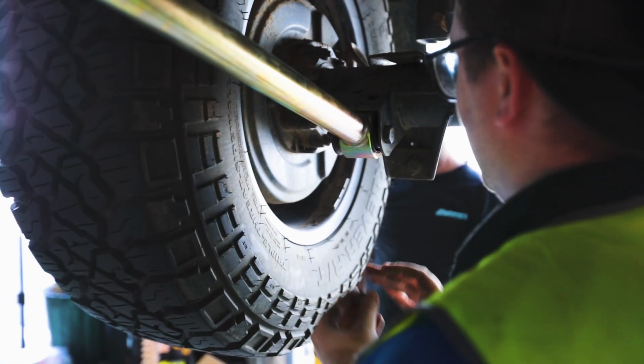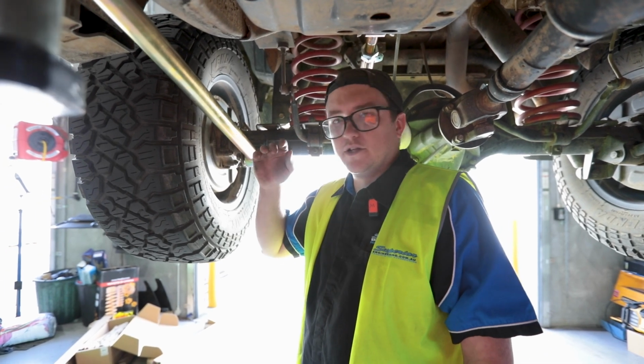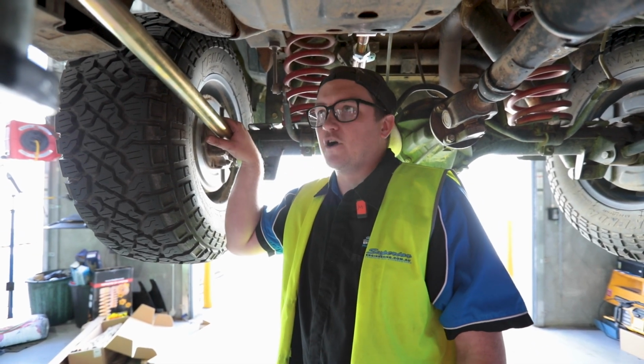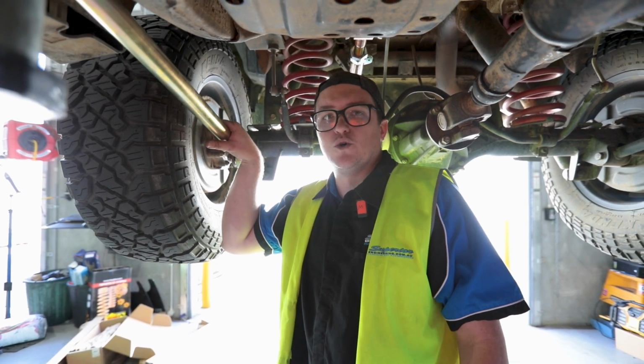As you've seen in that situation there, sometimes as you pull a control arm out, the diff will just drop backwards a little bit. On the hoist, it's easy enough for us to get one of the guys to come in, push the diff forward, and we can slot the bolt in, and that way she's all good.